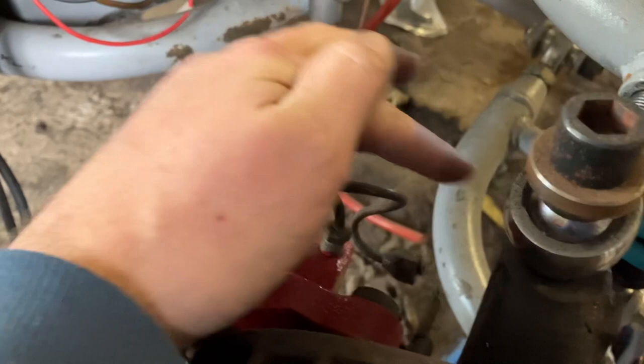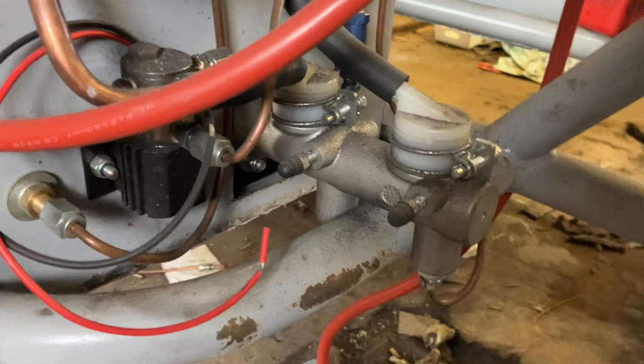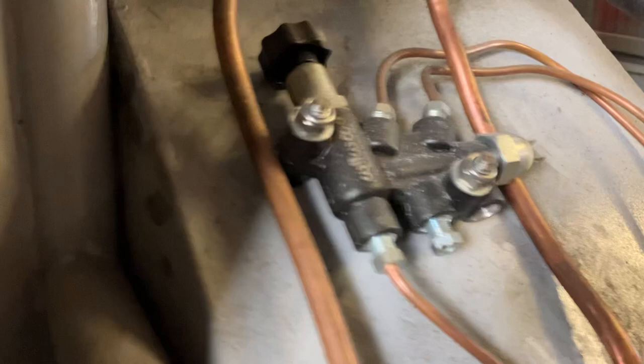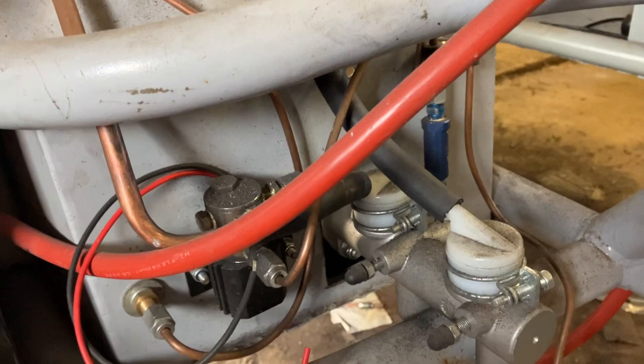We're still on this system but we're thinking of doing away with it — where you can mount a flexi-hose straight to the back of it, we're probably going to flexi-mount straight off the chassis instead. That's one of the next jobs. Down here we've got a Wilwood dual master cylinder, front and back. The fronts come straight out into a line lock, then up to a distributor valve which also has a one-into-two for the front, a brake light switch, and a balancing valve for the back brakes. The fill-up pots up there give access to keep the reservoirs full. There's also a pressure valve down here which keeps a bit of pressure in the front brakes — normally used for systems where the calipers are slightly higher than the master cylinders, just to remove some of the play out of the pedals.